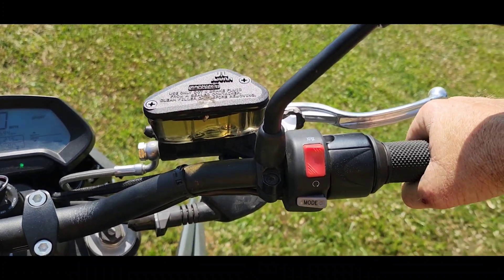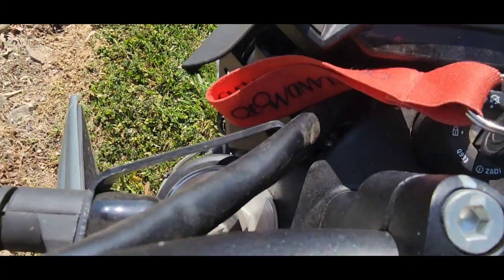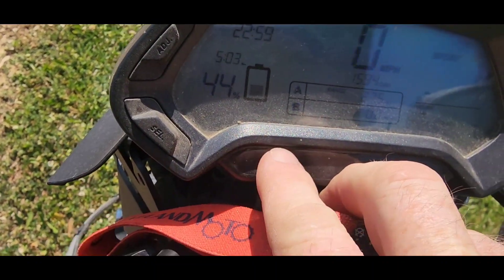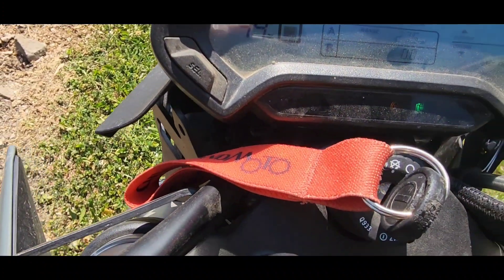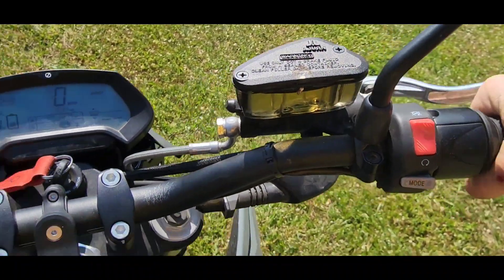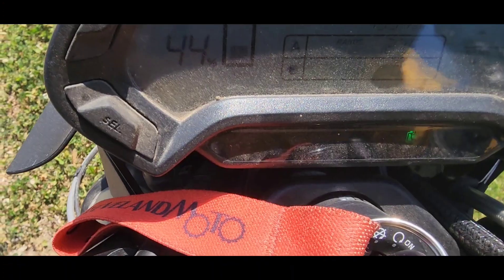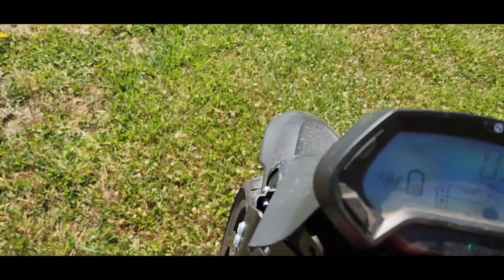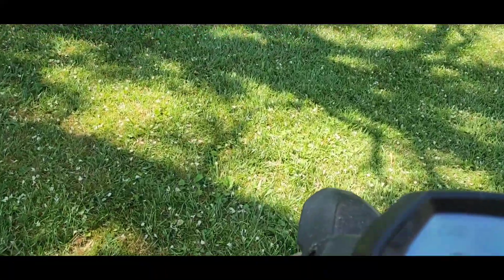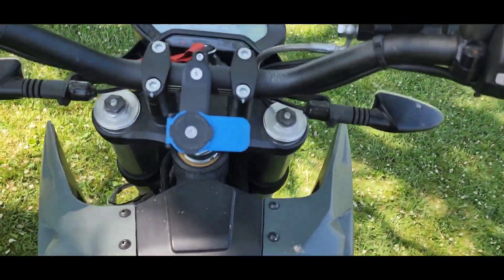I think I've answered the question — it's a lot easier to answer in the negative. Giving it some throttle here, keys on. See this little light right here — tells me the kill switch or something is on. If the kickstand's down, that light comes on. Kickstand up, keys on — and we're not going anywhere. So my guess is it will not move while it's charging. What if we just unplug it? Now let's see if it'll move. Yep. Good thing it didn't take off on me before when I was just working on it — it would have shot off. It won't work when it's charging.